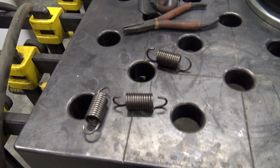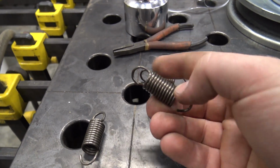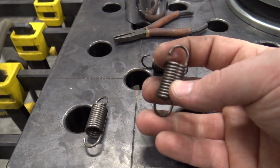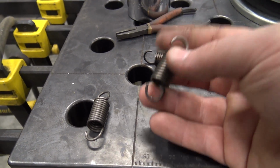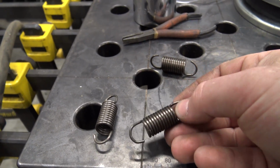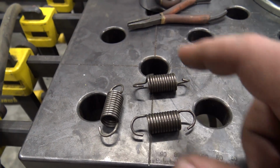In the next video, you're going to see us make so much more power than we did in this video because of what we found in the front drive pulley. So this is your typical stock yellow spring. It's not painted yellow because Go Power Sports has their own pulleys made. Comet would paint these yellow, but they're exactly the same as a yellow Comet spring. These are what come out of a brand new 40 series torque converter drive pulley. You have three of them that hook to rollers.